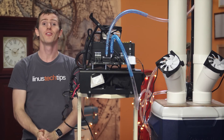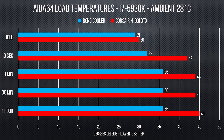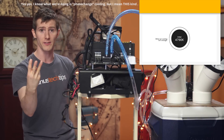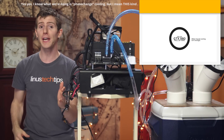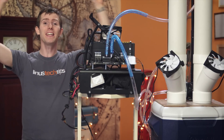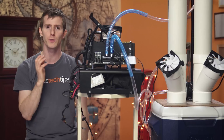Which leads us to moment of truth time. And here are the results. The advantage of bong cooling here is that we were able to beat the performance of a traditional ambient CPU cooler without adding a significant electrical cost. Thermoelectric or Peltier cooling, air conditioning, or phase change would incur these penalties. And the higher your air flow — our fans are actually kind of wimpy — and the lower the humidity in your environment — desert dwellers rejoice — the more effective this would be.